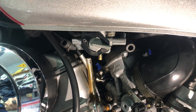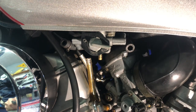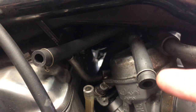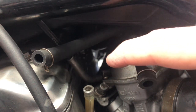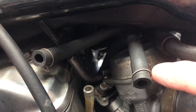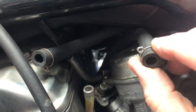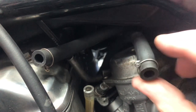If it helps, use a heat gun to get some heat in here and heat up the hoses — I find that it goes on the nipples of the petcock a little bit easier. Also make sure you've got these two hose clamps readily available at the end of your fuel line. If they've fallen back down inside due to gravity, take off the fuel tank, reach your arm in there, and grab these clamps first. These clamps help keep the fuel line onto the petcock. And if your Vulcan doesn't have these clamps or you've lost them, I don't see why you can't use zip ties or anything else to secure the fuel line onto the petcock so it doesn't come off.